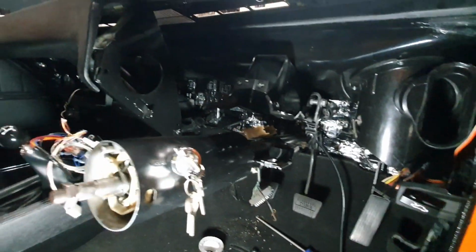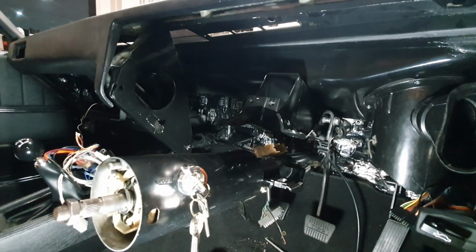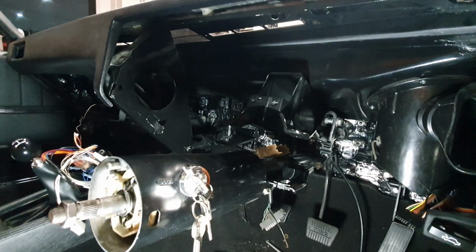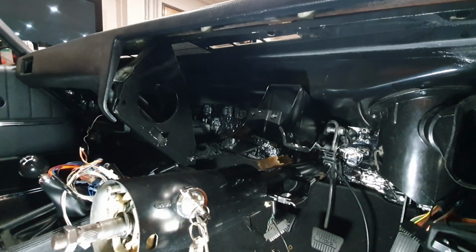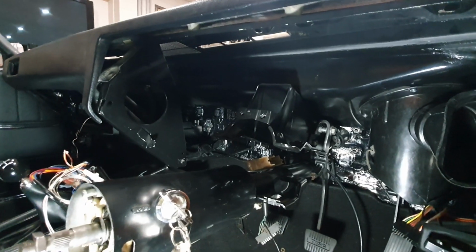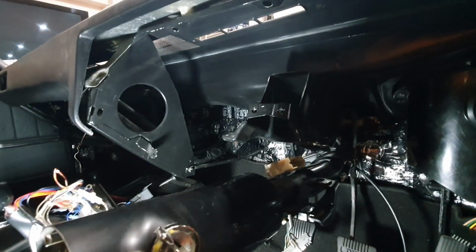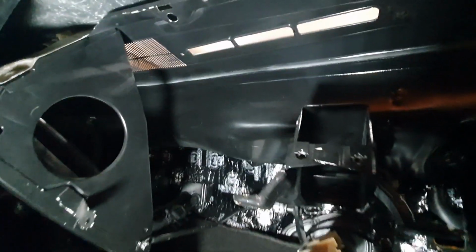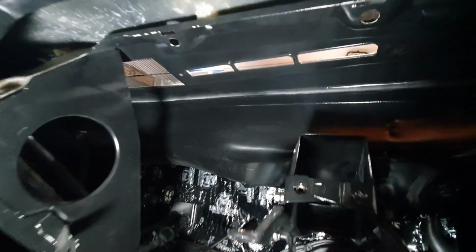So obviously to put that air conditioner in, we deleted the original blower and heater box that has all that internally inside it already, ready to go. So what needs to happen is we need to install the original Demister vents that go up under here. They're kind of like a whale tail shape. They fit out those 3 slots there, and there's 3 more across the other side.